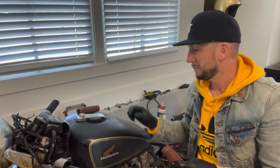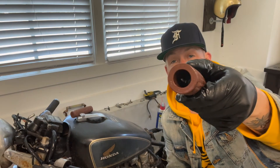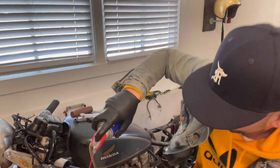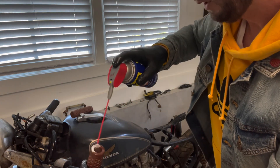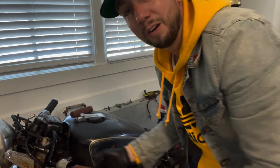We put on new grips — here's a pro tip. When the new grips come, you're going to have one that is wider than the other. That wider one goes on your right side, or throttle side, onto your throttle sleeve. The smaller one goes on the left side, or clutch side. Game changer: WD-40. Don't even try this without WD-40 — it's not going to go on. Spray your handlebar, spray inside the grip. Yes, it's going to be a mess, but it'll go on and you can wipe it off after.